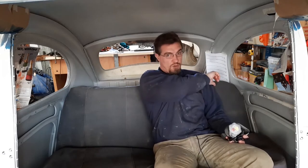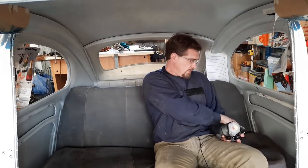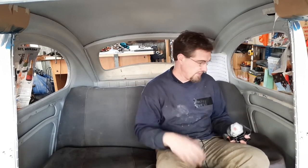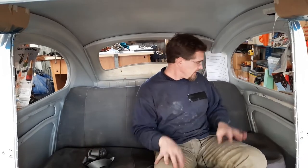For a lot of modern vehicles, you'll find that if you ever take them apart, if they don't have the space available, then they'll have the reel mounted separately, then your pivot point, then the lower seatbelt mounting point, and then your buckle mounting point. So it ends up being four. But it still acts in the same fashion. It just means you've got to make an extra plate and they all have to be strengthened in the same way.